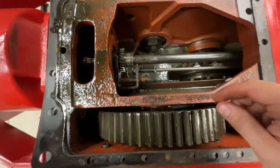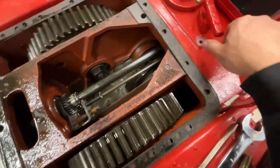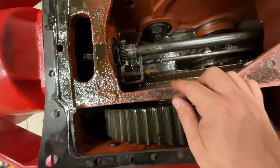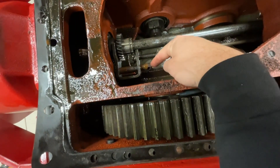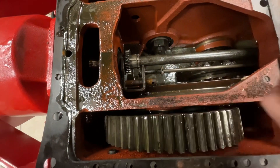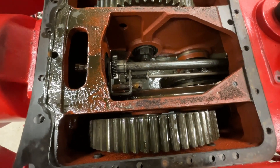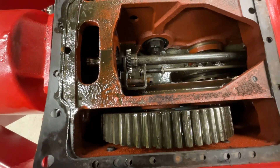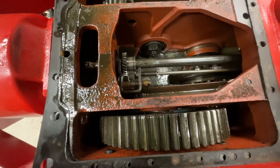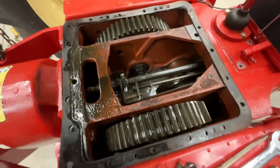What I found in this example was I could turn this all day long, and even when I had it in the on position it was still stuck all the way back — all I was doing was compressing the spring. Where it was stuck was on this shift rail. This thing had sat for 30 years and was completely caked with rusty, cruddy, nasty-looking stuff. I had to get in there and scrape all that junk off and splash some oil on it. Now it's effortless. I'm optimistic that I can put the top back on and actually get this pump project finished.